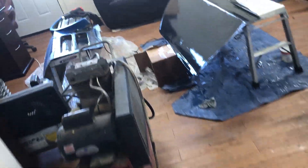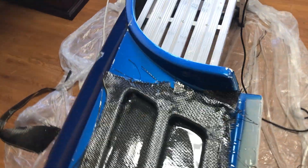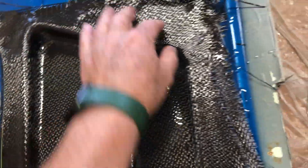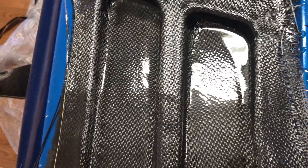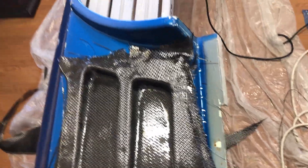That's my goal for today. I lost my helpers today so I'm by myself. That vent section I was talking about — here it is. So what we're going to do is cut out that fender at the opening right here. We've purposely left an extra inch or so on the outside that's going to get trimmed away, and then we'll use panel bond and bond this in from the backside after we accurately cut the opening.